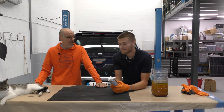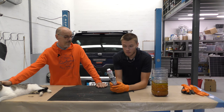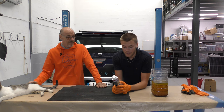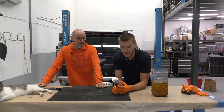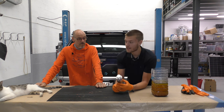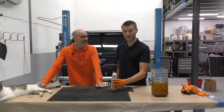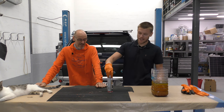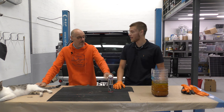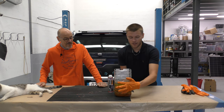It's a cold day here in Portugal — first of June and it's only 20 degrees and we're freezing. So we're going to try this radiator cleaner. It says to fill up the system with coolant or water — we're going to use distilled water. Then it says run it up to temperature for 10 to 30 minutes. I translated the instructions on Google. We're going to run it for about 20 to 25 minutes up to temperature and see if that makes any difference.